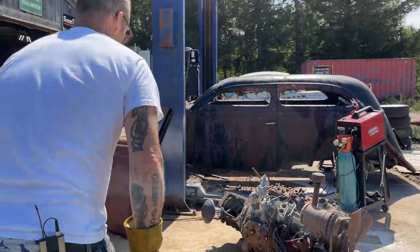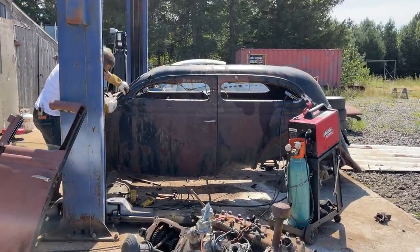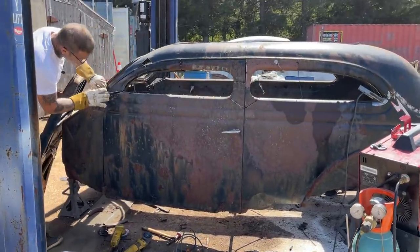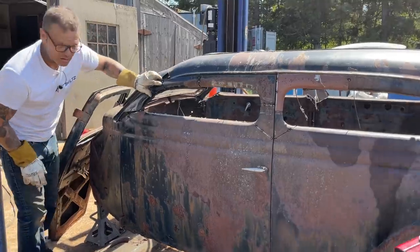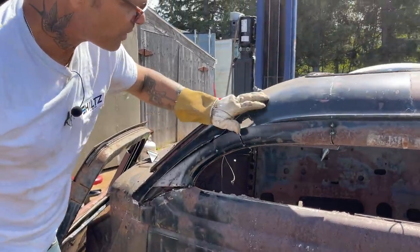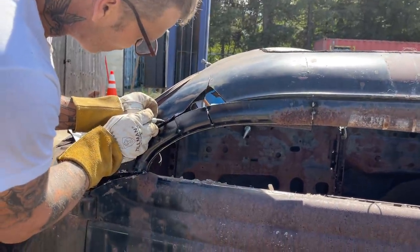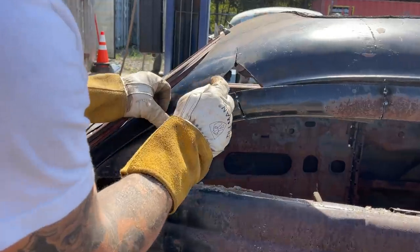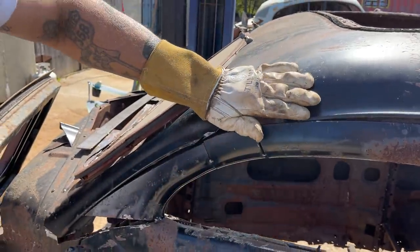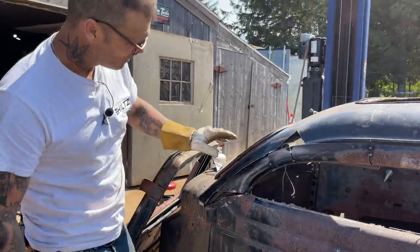What I'm going to have to do is put a piece in the door here. That's going to have to make a piece there. That's no problem. Just come up straight and make a piece to fit that. Coat hanger, weld it, grind it, make it look nice. This here piece, I'm going to take a piece of ramrod, weld the piece of ramrod here, and go with the shape of the door, weld it up in here, and then I'll make a new piece that lays on top. That's probably what I'll do when the camera goes down.